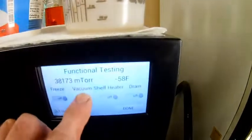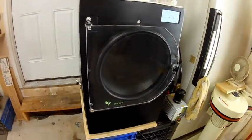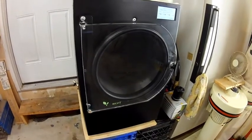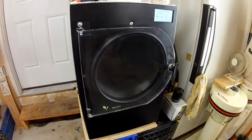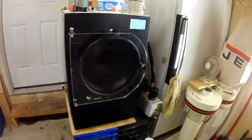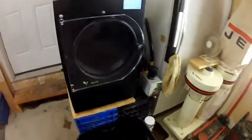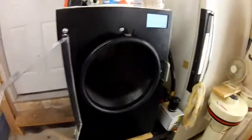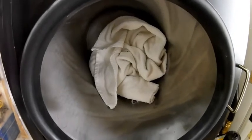We're going to go one step further and I'm going to show you some other troubleshooting tips and hints to find out what happened to your vacuum. The first thing you need is some soapy water. Before you perform these tests, you want to protect your freeze dryer and your pump. We've already removed the tray from inside, and we're going to put a couple of towels in the corner to intercept any moisture or water used during the test.